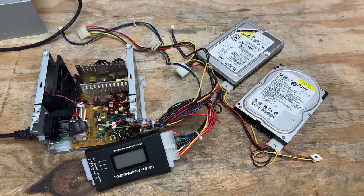That was a lot easier than I thought it was going to be. Let's see what that fan is sounding like - and it sounds terrible. Let's see if I can help that bearing. Let's go ahead and yank that label off to get out the bearing and drip some oil down there. Now let's turn that on and let it work in - it's already sounding a lot better. Now let's clean up that excess oil, use some Kapton tape to seal it up, and sweep that heatsink out.